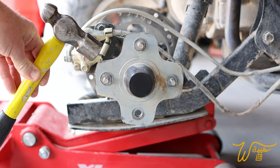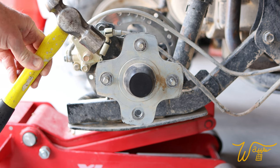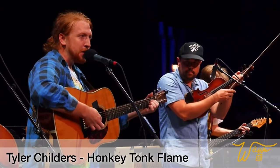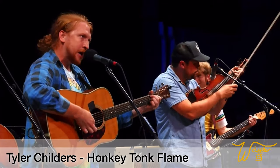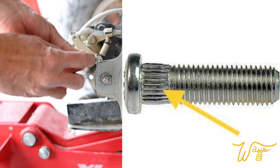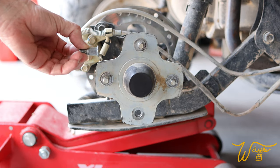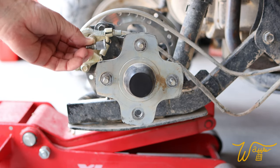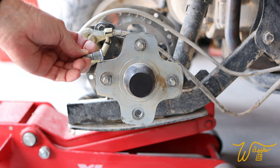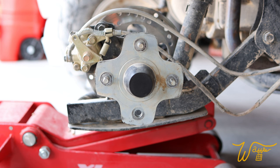To get these wheel studs out, we're going to have to do it the old-fashioned way with a hammer — you've got to beat them like they're owing you money, to quote Tyler Childers. The reason is this part here, called the knurl, is like one and a half to double the length of other similar wheel studs. Because there's so much footprint on here, it is really hard to get these out. So maybe even some hearing protection.